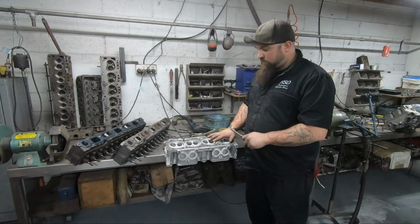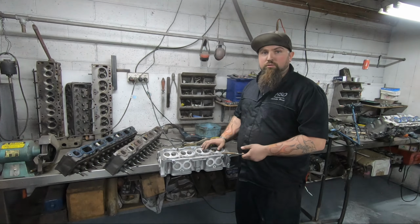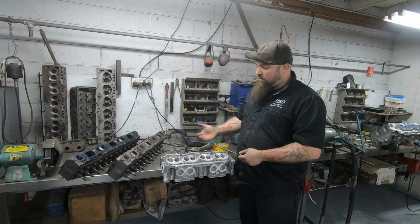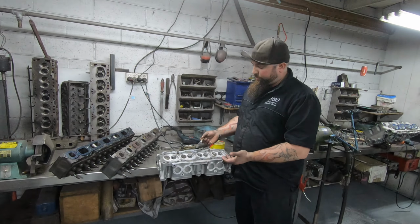See, this engine having a stock camshaft, it'll only have a maximum of 350 thou lift. If I flatten that out a lot, it'll actually go backwards because the valve will never lift past where it's productive.